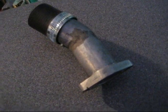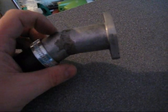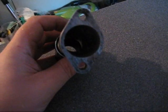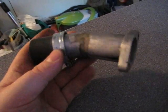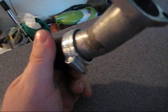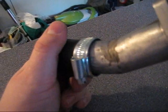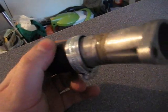Here's the intake manifold I was showing you. What I did was take the original manifold, cut it down into sections, and then mounted it on the lathe and bored it out to 28mm, which worked out very nicely, and then took it to a guy to get it welded up. The inside edge was a little thinner so he didn't want to weld it too much and risk melting through it, so there were just a couple of pinholes that had to be filled with epoxy.